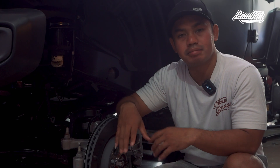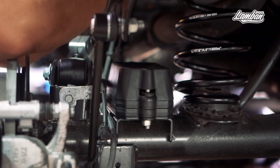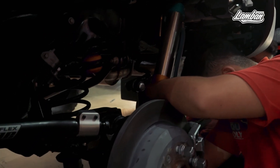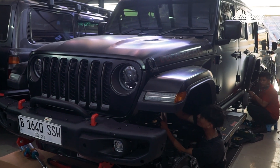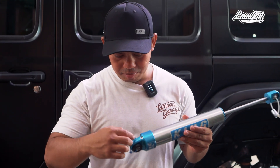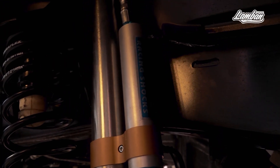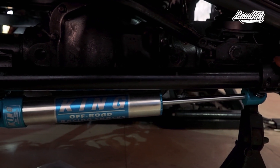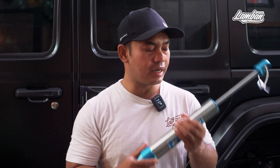We can put the track bar. The track bar has a problem on GL — it must be changed. So the track bar in the middle needs to be replaced. This is a shock absorber that I highly recommend because the price is not expensive but it is available. The nitrogen can be set up and the valving inside can be tuned to adjust stiffness. Compared to SP or Falcon, that is 9 juta — this is a good option.